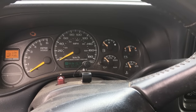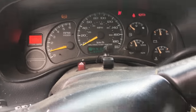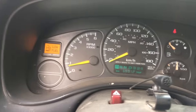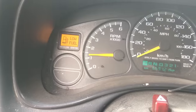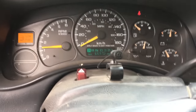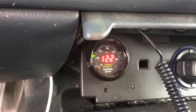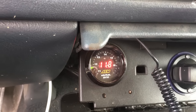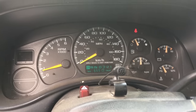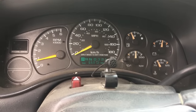With those two changes made — increased idle RPM and idle airflow — let's see if that helps. It's still running pretty rough, but at least I'm not having to hold the pedal to keep it running. The RPMs hang a little but it should be drivable. I can tell it's pretty rich; I'm at about 12 on my air-fuel ratio gauge, so I'm going to go for a drive and try to get my VE table dialed in, then come back and fine-tune the idle.